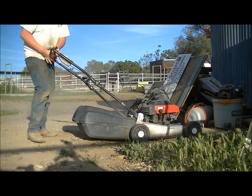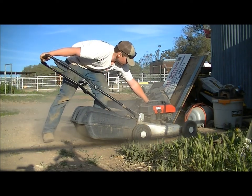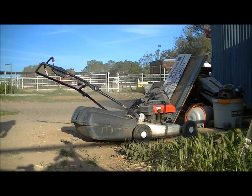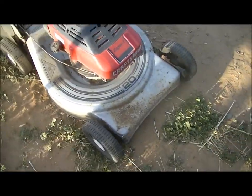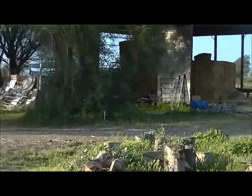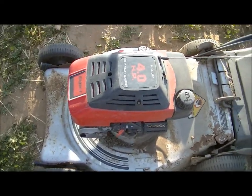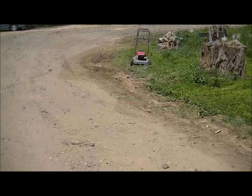Well, it does start and seems to run fairly well. No kickback, which means the flywheel key is good. It doesn't idle very well. My battery's almost toast so I'll say goodbye right now just in case. Thanks for watching, but anyway, yeah — seems to run pretty decent. I've got a deck for this thing. I think I'm gonna pull this motor off and put it on the deck, or I might put it on that two-wheeled weed eater you see right here. It's currently my engine stand for a blown Honda motor. Let's see how much oil it has. It's over full — that ain't good.